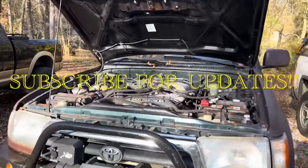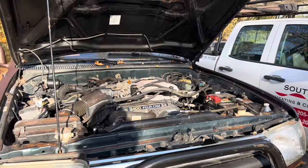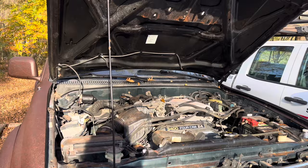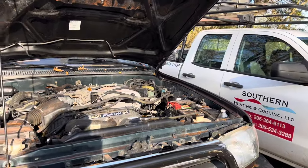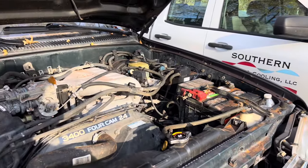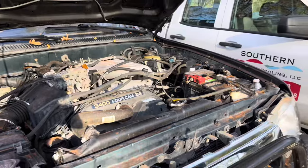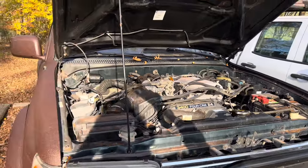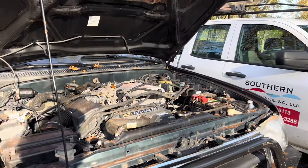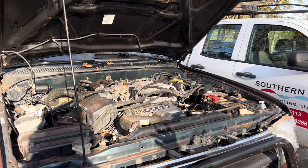We're having an overheating issue that started after we got back from our North Carolina trip. We put 1,638 miles there and back on it with no issues. As soon as we were coming back through Atlanta, it started overheating. We found out it was out of water, topped it back off, kept driving, and constantly had to add water. Then the heat quit working, so we thought maybe the heater core was stopped up or leaking.